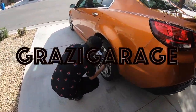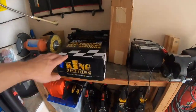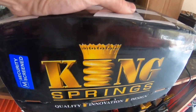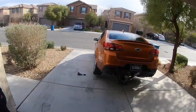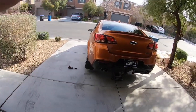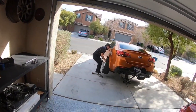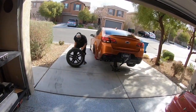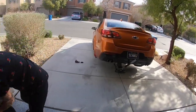We are doing the King Springs install. Right here, King Springs, doing the install. Gotta pull the wheels off, got the car jacked up, chalked in the front. I had to start with the rear — gonna pull the rear coilovers off, compress the springs, put the new ones on. I just bought a McPherson spring compressor, last used it on my sister's FJ Cruiser.